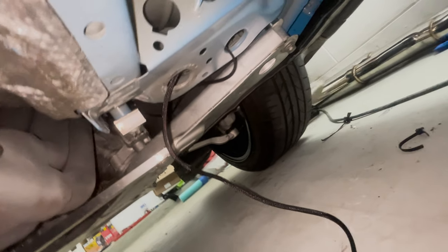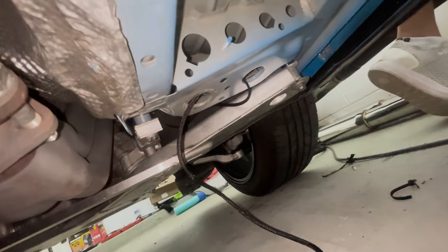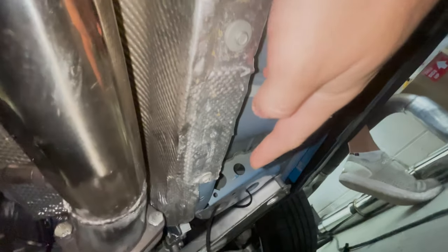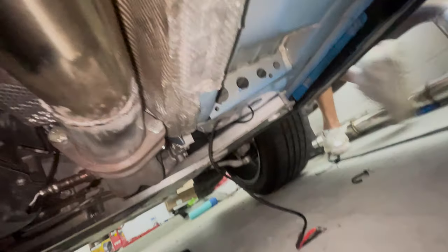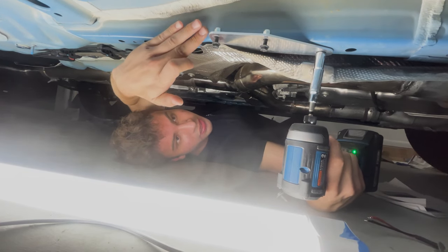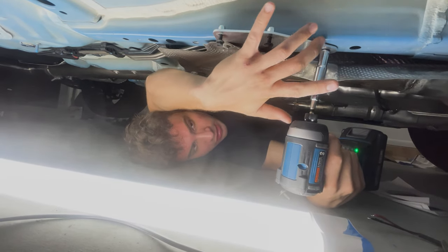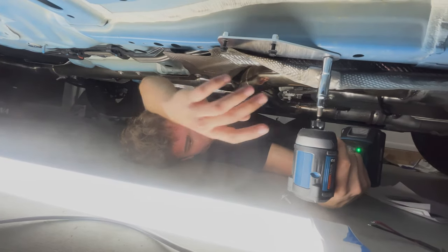After you run that wire through the fender liner, there are two holes, and we'll run the wire through and loosen up bolts one, two, and three to mount the pump bracket. There's not much room underneath the car so I'm struggling a bit, but your two wires will run all the way from there to about here. Now we've got the bracket all mounted up — the orientation has the 90-degree turn pointing towards the back of the car, then it slopes down to where the aux fuel pump mounts.